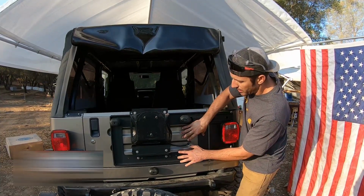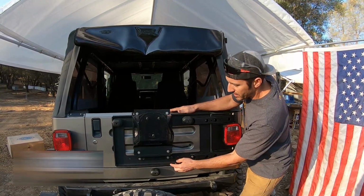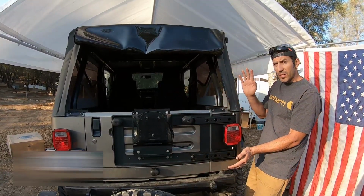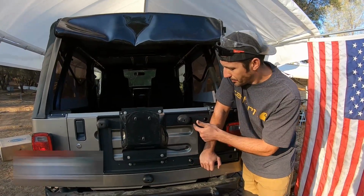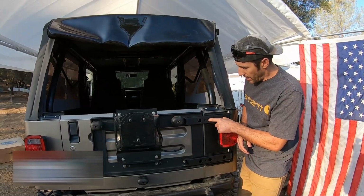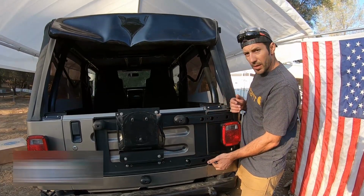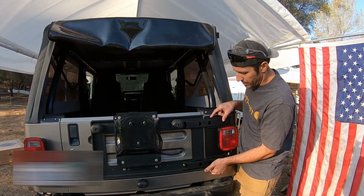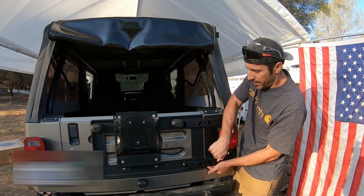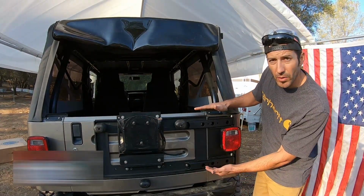And once it's secured to the tailgate, we had to align it. We made sure that was square because I didn't want to think about anything else. I just wanted this plate square to the tailgate, and then once it's square, we tightened it and left it alone. And then the third step was put the bolts in and made those tight, and then we had these bolts already in here that were loose, and so then I put an up force on these hinge plates right here going up, again also to reenact the weight of the tire, and then tighten those. And then as you can see now, we have a nice level installation.